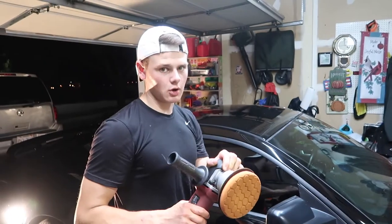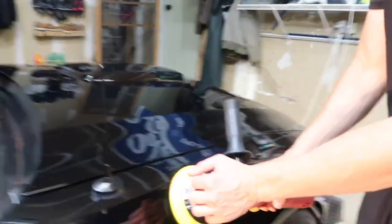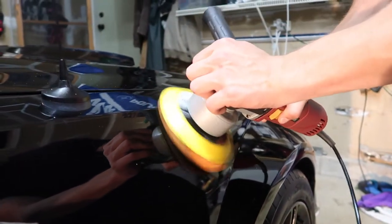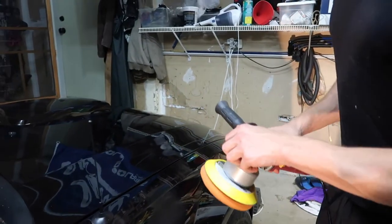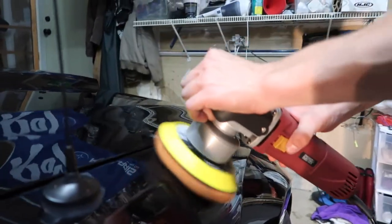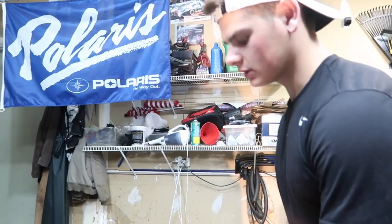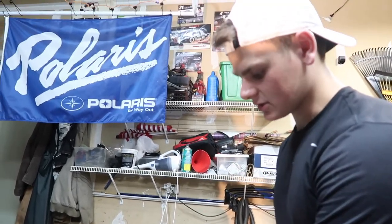So let's talk about how hard you should push when you're polishing. You don't want to push so hard that the polisher shuts off - I'll show you on a low setting as an example. If you push too hard, you can hear how hard the polisher is working. That's really doing no good for your paint - you're just going to put burns in your paint and it's going to come off on the pad. And if your pressure is too light, you're going to get a lot of spray going everywhere. So you don't want to press too hard where the polisher is burning your paint, but you don't want to be too light where it's spraying everywhere and doing nothing to your paint. You want just a light, even pressure - set it down, press a little bit, and let the polisher do the work.